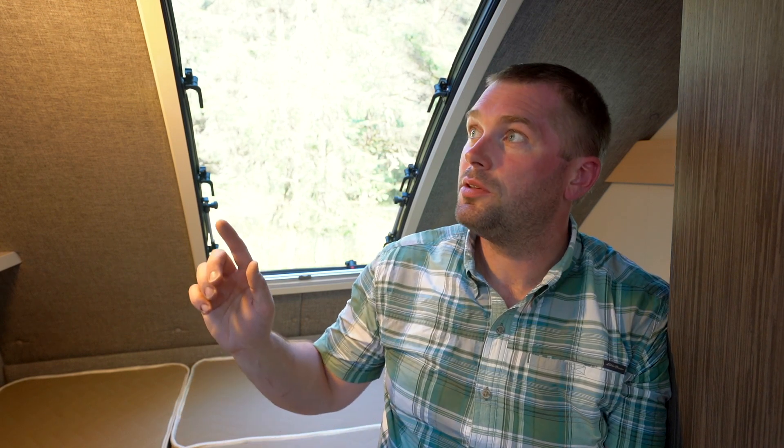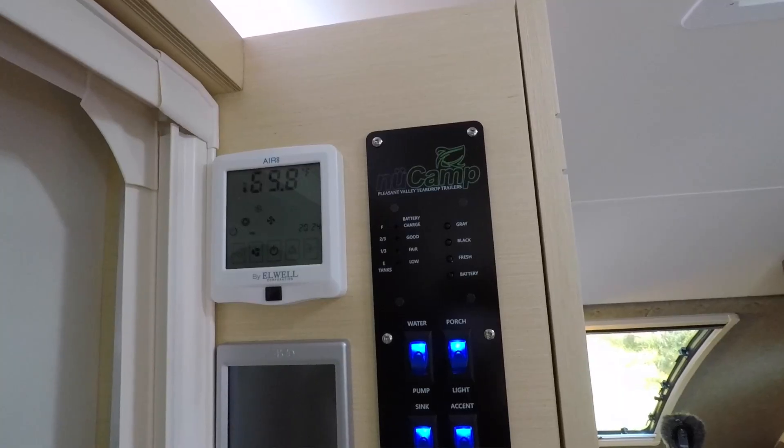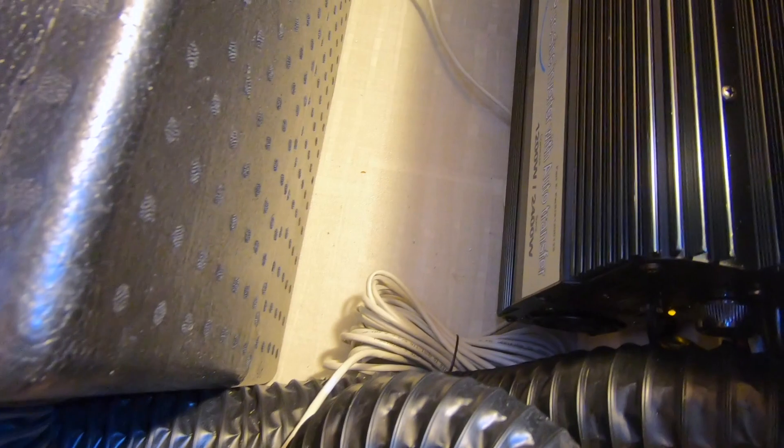You've actually done all the hard stuff. Now you're probably wondering where do you actually put the battery monitor itself? You can run that telephone wire up above the cabinets over to the monitoring panel where all the other monitors are. But in my case, there's one special thing about the BMV 712 monitor, and that's really why I chose it — it has Bluetooth. So I just decided to leave the monitor underneath the bed, coiled up the cable, secured the monitor so it doesn't bounce around during travel, and I connect to the monitor through my phone. That makes setup and reading the battery a lot easier and gives you a lot more information than that little LCD screen can provide.